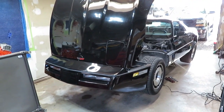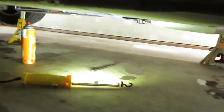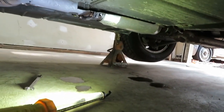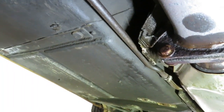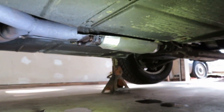Today we're going to take the catalytic converter off and punch it out — it may already be punched out, we'll find out in a minute. I got the bolts soaking in Kroil, or penetrant I should say, for those who don't know what Kroil is. This stuff right here — if you let it sit on there long enough it'll pretty much loosen up any bolt. I got four of them, they're 9/16s, and there's a little pipe on the other side that connects to the converter that I have to disconnect.